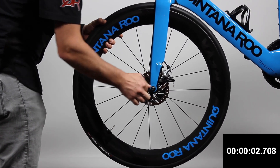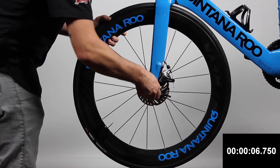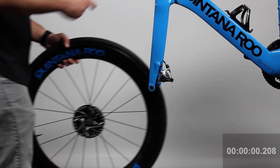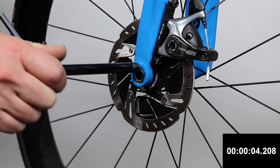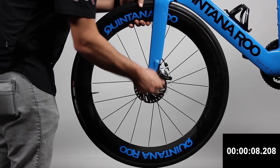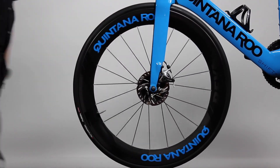Let's see how long it takes to remove the wheel in total. Installation of the front wheel is just as easy. Line up the front disc rotor with the disc caliper, then insert the wheel between the fork dropouts. Insert the thru axle and thread it back in, ensuring you're tightening it down to 10Nm.